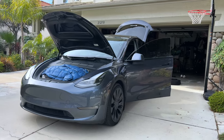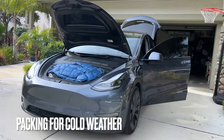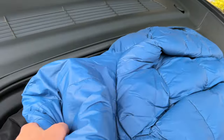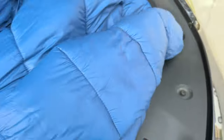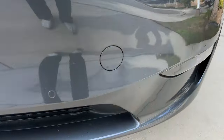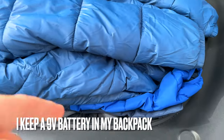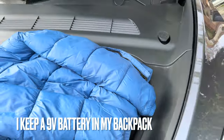So this is our Model Y. We have done this trip in the winter with our Tesla Model 3 — it took a little more creative packing, but it is still doable. Here we go with the frunk first and foremost. Here is how we are packing it: all of our giant puffy warm winter jackets as well as boots. I also pack a battery jump starter in the frunk. Why? Because if the car is dead and needs a jump start, you need to access this panel here with a 9-volt, which will be enough juice to pop the frunk, and then from there I can take the jump starter and jump start the 12-volt that's inside there.